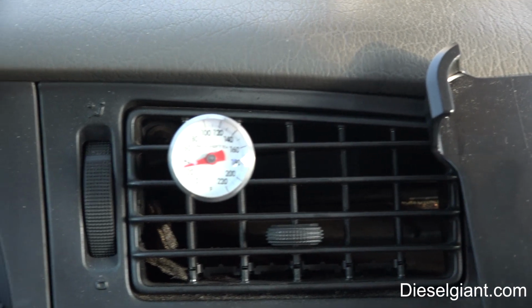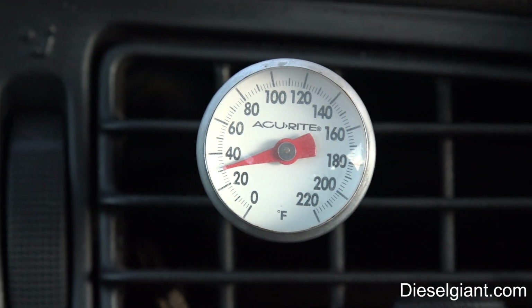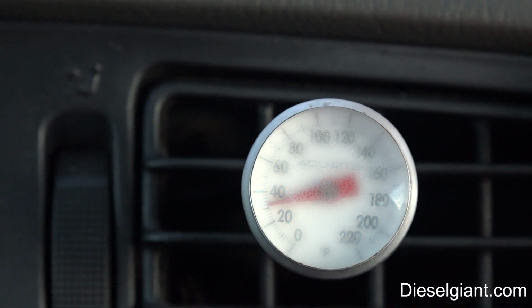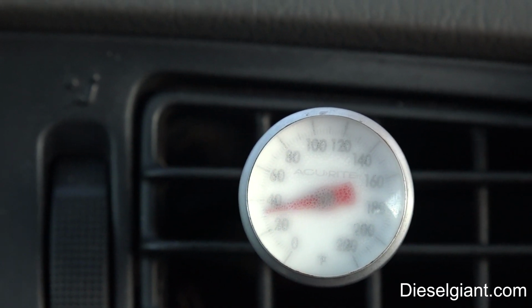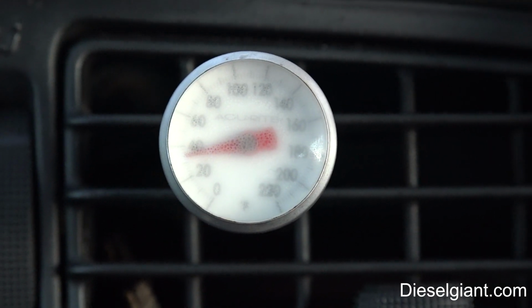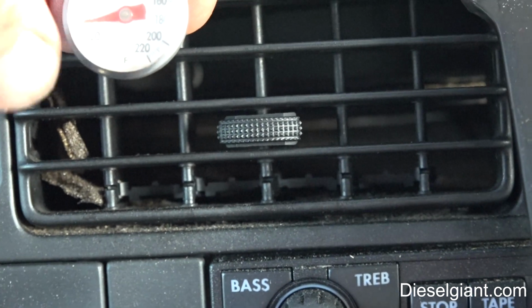The absolute best way to ensure you have the correct amount of refrigerant is by weighing the charge in an empty system. You can go by the pressure and temperature chart and the PSI on the gauge if you're not sure, if you're just topping it off, but if I did that, I probably would end up having a little more in there.